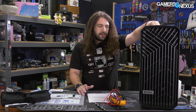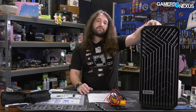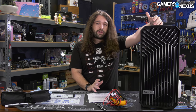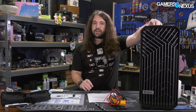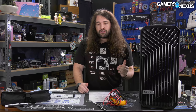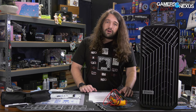Be advised, however, if you have limited motherboard fan headers, don't split them too many ways, because fan headers are limited on how much current they can take before they melt. That's true of all motherboards — that's not a Fractal thing. You don't want to plug three relatively high current fans into one header. A lot of headers are rated for about one amp, some can do two amps — check your manual if you're going to start doing Y connectors and daisy chaining things. We also asked, are there any exclusions? Any regional exclusions? Fractal says there are none — all regions and all customers are eligible.